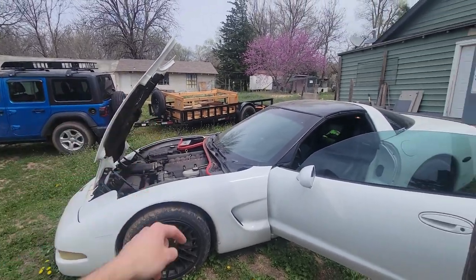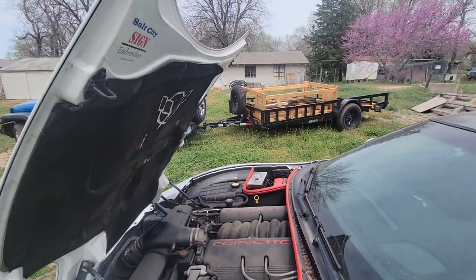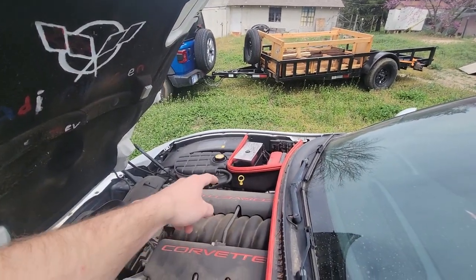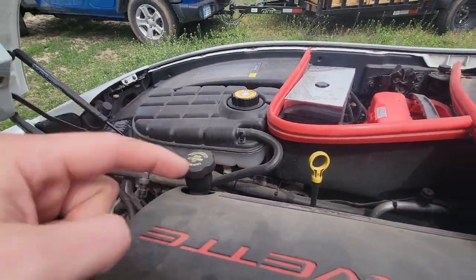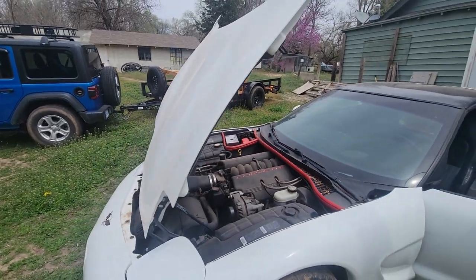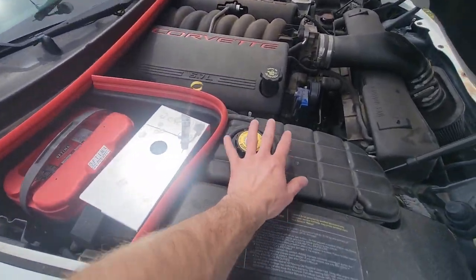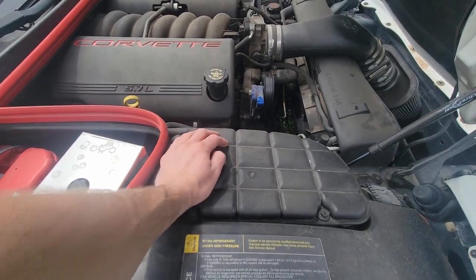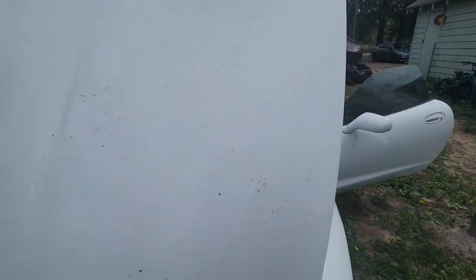What I'm talking about is the sensor — because that sensor I took from the old tank and put in the new one. Right there you can kind of see it — it's right there. I bet it's leaking from there, just because on these older Corvettes they're supposed to be built in and not able to buy a separate one. Well, I bought a tank that did not come with the sensor, so I'll have to look into that.